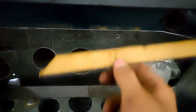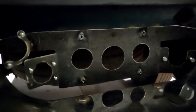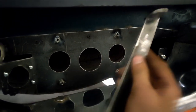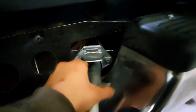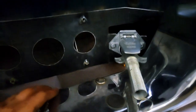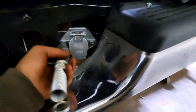Just got this little bracket mounted up. Got to weld it fast to the rest of the thing yet. Sorry for all the close-up shots — I don't have very much room between me and the garage door. Nuts welded on. Got one of my braces cut out and bent. I'm going to stick this up there, self-tapper it up to the bed rail, and we'll see if that helps. Wow, even with just one brace in there, that is a lot better. It's still got a bit of flex when you plug it in, but I think if I cut it out of 3/16th plate or didn't have quite so big of a hole there it probably wouldn't be as bad — but this is fine. I can live with that. Doesn't feel like you're going to yank the thing off the back of the truck when you pull it out.